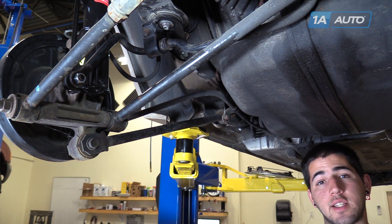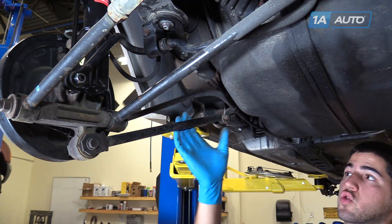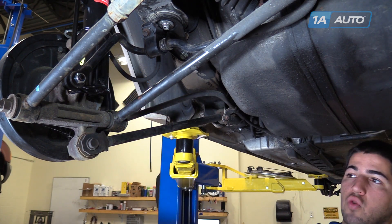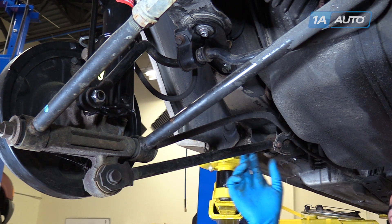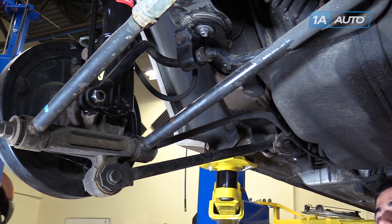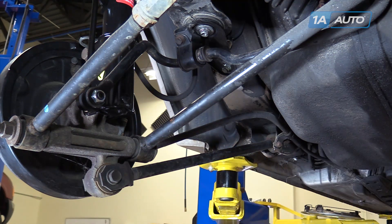In this video, we're going to be working with our 1998 Toyota Camry. We're going to show you how to remove and replace your rear trailing arm. What this does is it keeps the suspension where it's meant to be and controls the travel of the suspension so it stays within a designated movement. These can have the bushings wear out or they can become weak and rusted or bent from collisions or other things on the road, putting a lot of force on them. This can cause some vibrations, some clunking, the suspension will be out of line so it may go down the road odd, create some weird tire wear, noises, vibrations, et cetera.